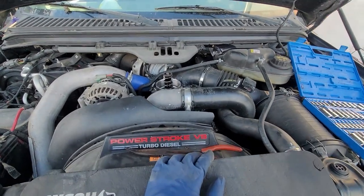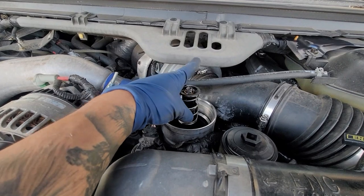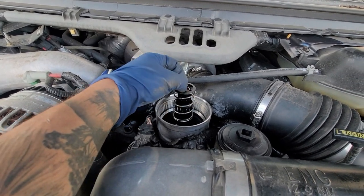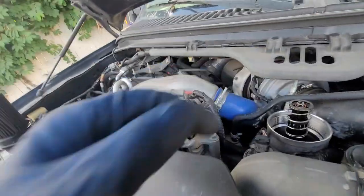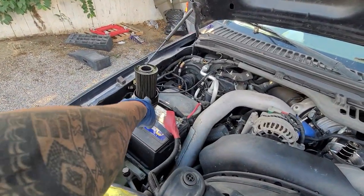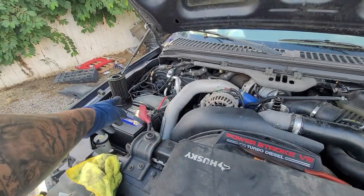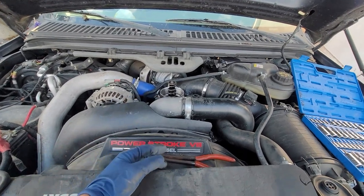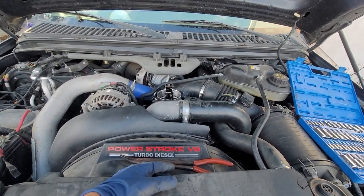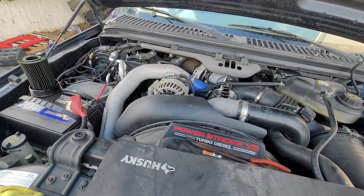Right here we have an oil filter — this would be called the return pipe. So obviously as you can see, this one broke. Whoever put on that filter pushed on it too hard; you can kind of see how it collapsed. The oil filter doesn't have that many miles on it, and they're having a little oil pressure issue — they just got the oil filter done and then went to a quick oil change spot.